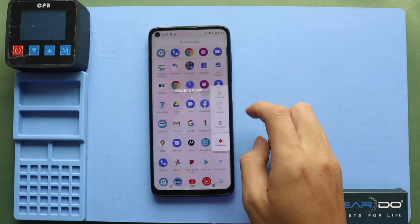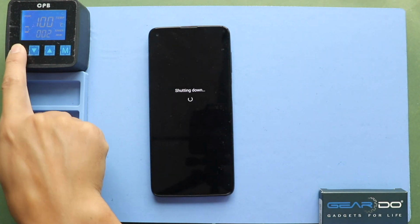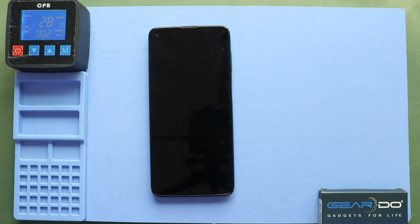Today we will show you how to replace LCD screen assembly on the Motorola Moto G Stylus 2021 mobile phone. To start, we need the right tools to proceed with the repair, which you can find in the description. First, take out the back cover from the body.